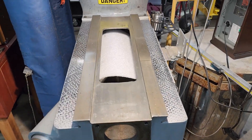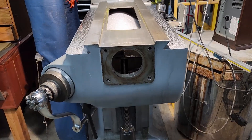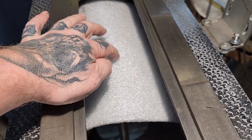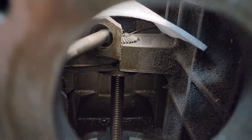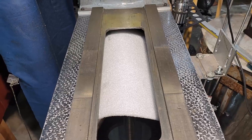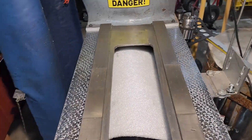About to put the saddle back on. I've been doing more cleaning, cleaning up the ways back there, raising and lowering this thing. I found something that should stand up against oil and chips, which will guard the gearing there from getting loaded up with chips in the future. Anything that does get in here is going to end up getting stuck here first. I'm going to buy some skirting so when this all gets assembled there'll be rubber skirts on here, which will prevent any chips from getting on this.